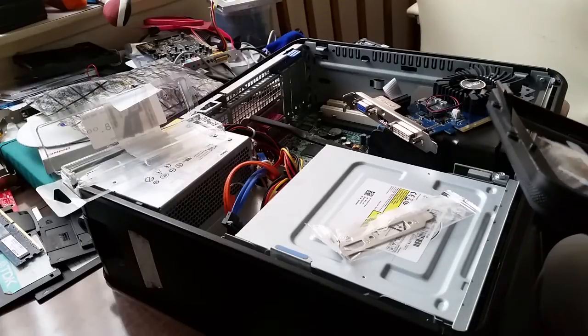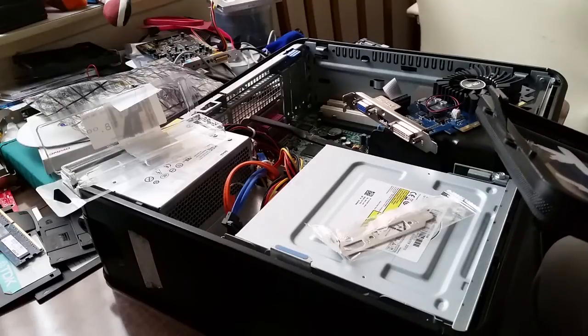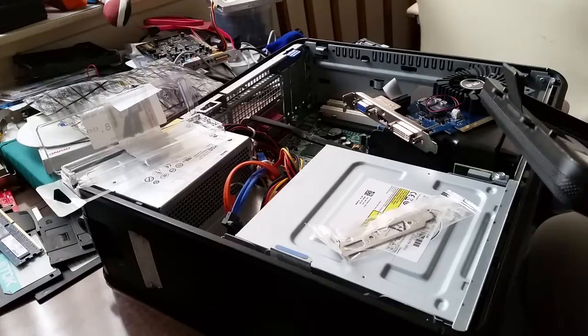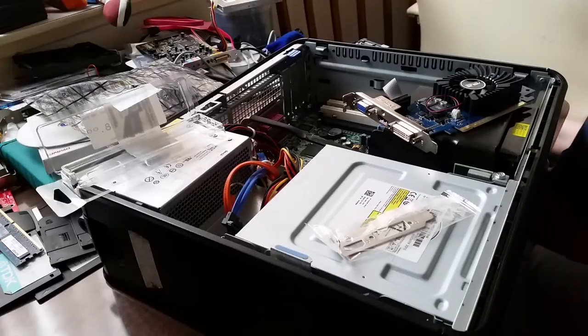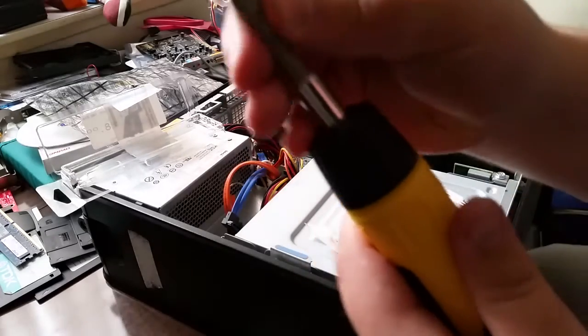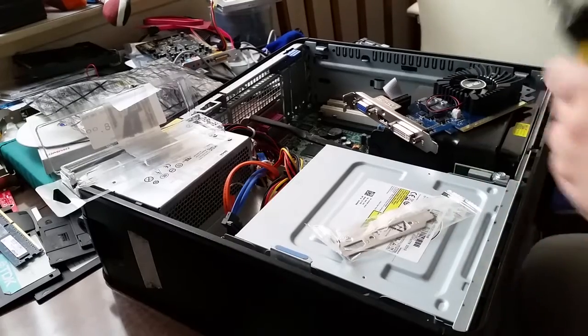You can't usually read the sizes on this. Okay, I've just got it. It's a 6mm socket. Hopefully that will be the right size. You don't want one too big because it won't actually grip onto the standoff, and you don't want one too small because then it just won't even fit over the standoff. And I'm going to equip my Stanley screwdriver with it.